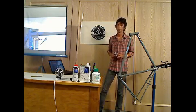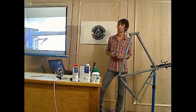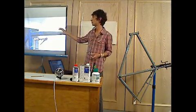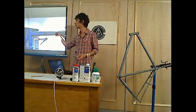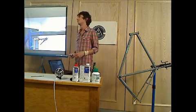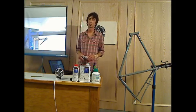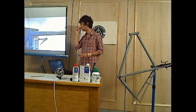You've mentioned with carbon fiber that you have to bond it with another stuff to get a surface. When you're just clear coating over the carbon fiber, how do you? Oh, just over the bare carbon fiber? Yeah, that can be tricky too, because a lot of times it's pretty dirty. You obviously want to clean it. It depends a lot on what you clean it with. But that's true, because there are little fisheyes a lot in the carbon fiber. Like in this area, there were always little pock marks and little voids. There's different cleaners that companies like this make, usually an alcohol-based kind of stuff. I think I used one for carbon which was different than anything else I used. But yeah, you want to get some pretty serious stuff for this, definitely.